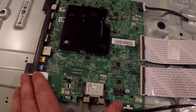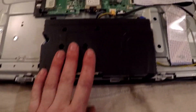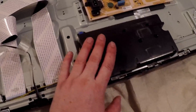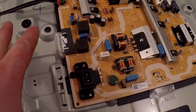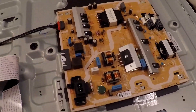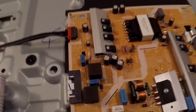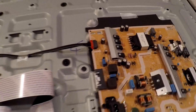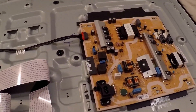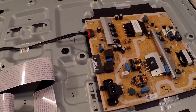What we have here is the main PCB board — this is your brains of the TV. Here we have a speaker, another speaker. We've got your power board — this deals with all your incoming power and the voltages it produces. Generally, when your TVs stop working, it is the capacitors. These electrolytic capacitors, a lot of them have a wearing-in phase, where they will last for a certain period of time, up to three years.